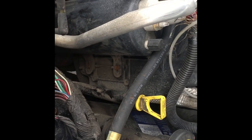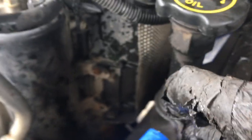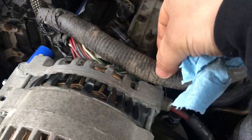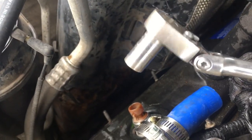We did end up having to drain our coolant — mainly because of the coolant filter. That pipe off, we had to take all that out and drain the coolant. As you can see now, we have our wires completely flopped over and our trans dipstick is off the stud. I found that using a quarter-inch ratchet with a mid-depth 10-mil is the key to getting that one off.